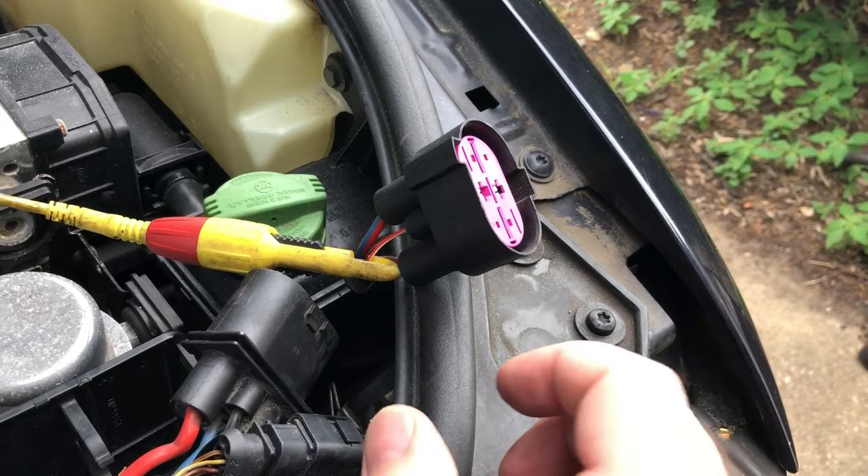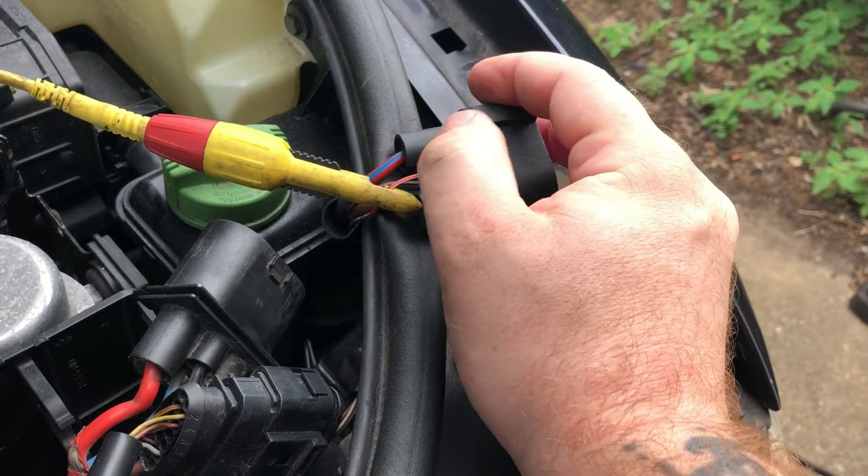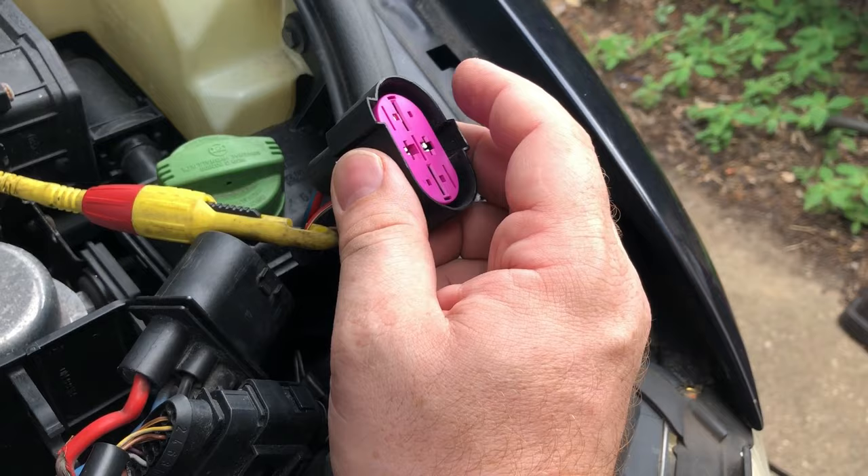What I'm going to do is actually de-pin this connector. It's easy enough — you pop off this purple cap, there's a lock in there, you slide the wire out, put everything back together, and we're good to go. No harm, no foul.